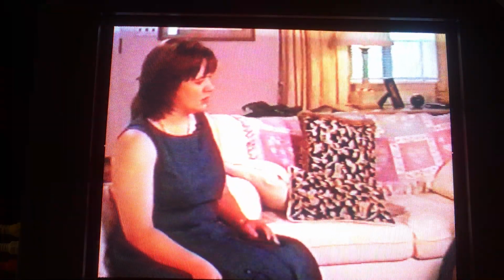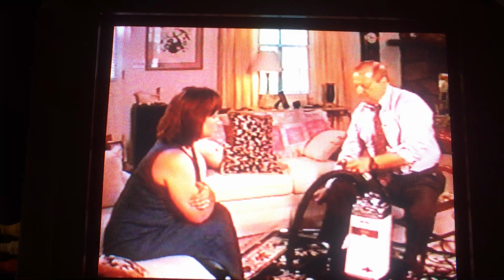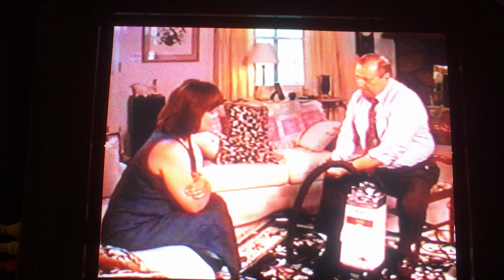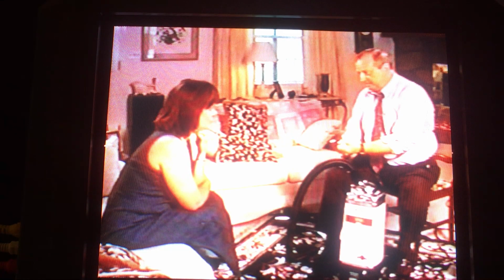You're changing that motor. Right. What do you think happened? Bag stopped up? Bag is stopped up. That's right. I'm going to do that again, but let me show you what happened first. Here's what happened. We stopped the pores of the bag up where it couldn't pull air through it. Once you stop the pores of the bag up where air can't get through it, you can no longer pick up dirt. And I'm going to do that again. I'm going to show you that.